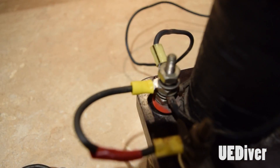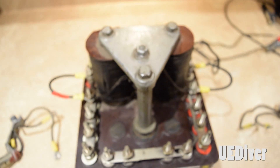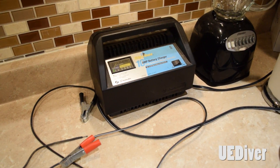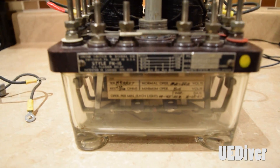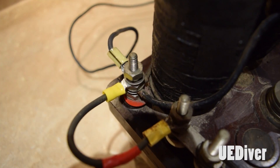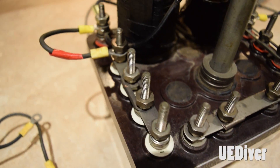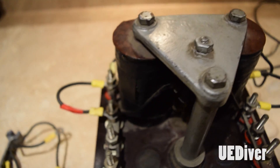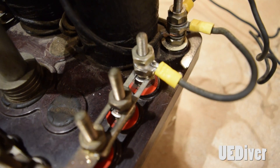On the back here, you've got your positive lead over here and your negative lead over here. When I originally hooked this up, I just hooked the power source up — positive and negative — to my 12-volt battery charger that runs at 10 amps. But when I did that, I got the unit to rock back and forth inside but couldn't get any lights to light. After some help from my friend, I figured out that I had to jumper the leads — one here to this set over here, which is going to be your FL positive. And then on this side, the same thing — took the main wire coming in off the battery charger and jumpered it to these leads, which are going to be your FL negative.